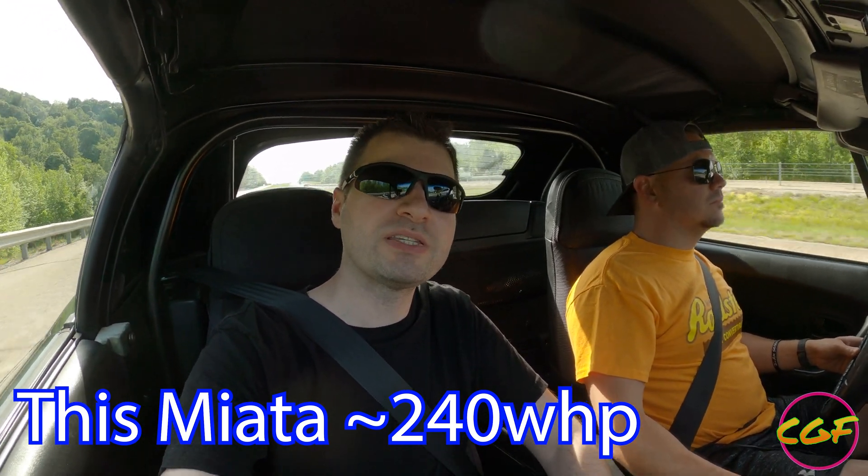At this point you're thinking: do I want a 3.6? Is it worth the money and time? It really depends on how much power you have or plan to have. This is probably the minimum amount of turbo Miata power I'd suggest for a 3.6 install. If you're less than about 220–230 wheel horsepower, you probably wouldn't have fun with a 3.6. If you're up in the 300–400 range, this would be absolutely perfect and your car would probably be faster. I hope this 3.6 install has been informational and entertaining — if you enjoyed it, hit that subscribe button and feel free to hit the like button.